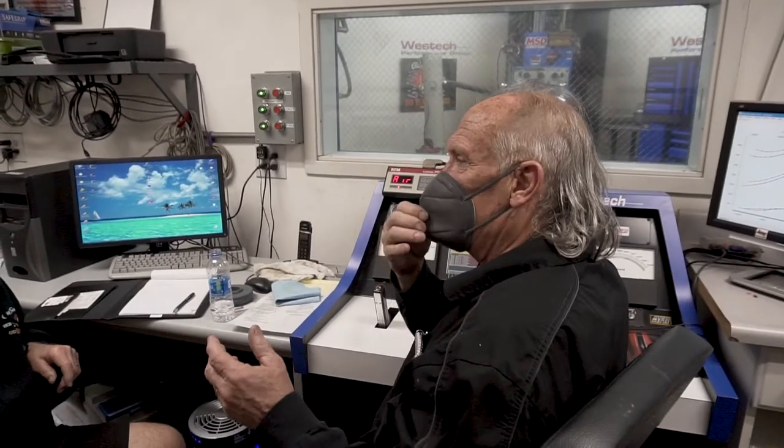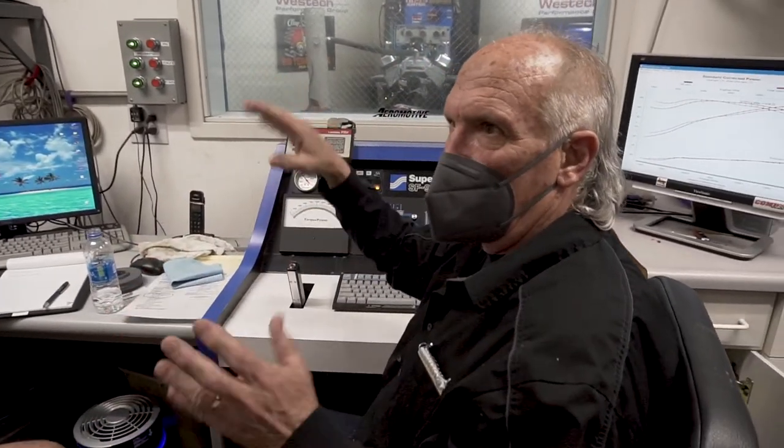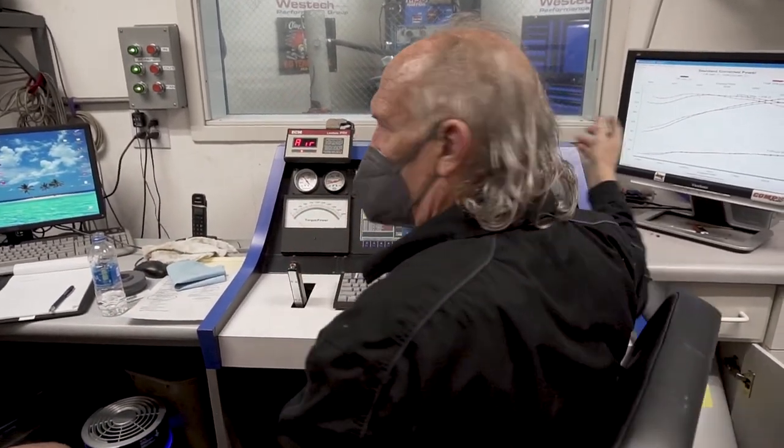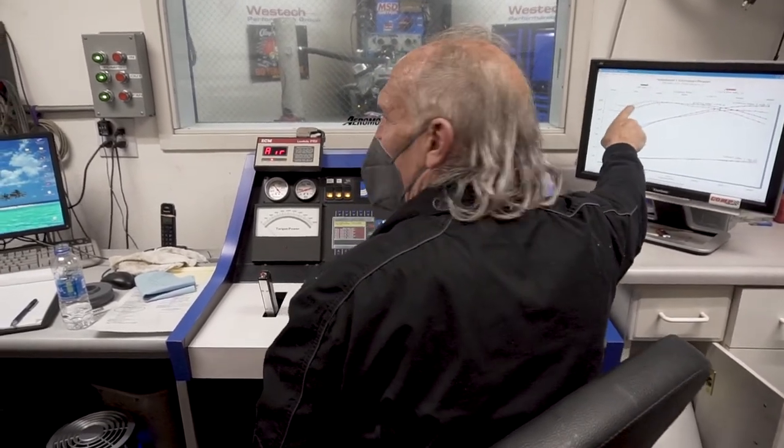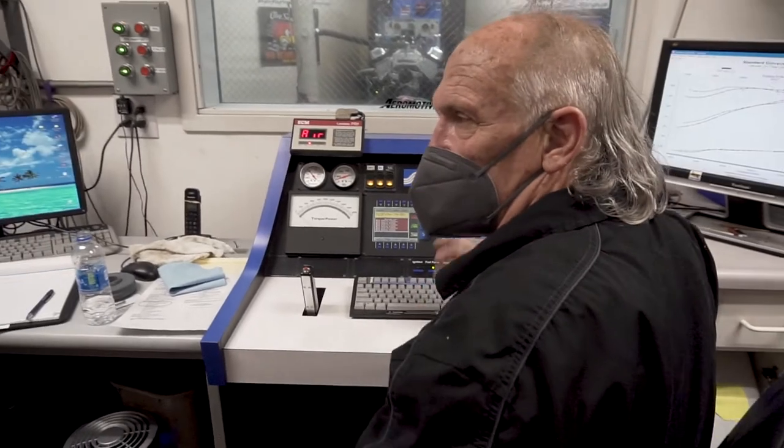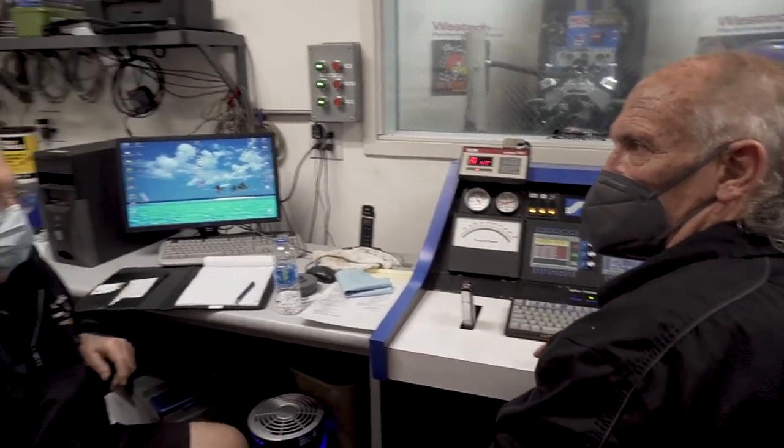And that's what I kept saying, the camshaft just contours where you want the power. If you want to go drag racing, then you obviously want the bigger cam. If you want a street car, you might want the smaller one, so you're really just contouring the power curve. It's doing exactly what it's supposed to do.